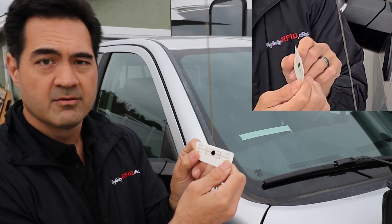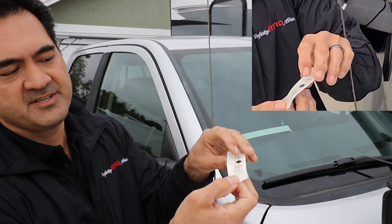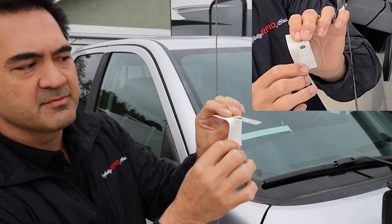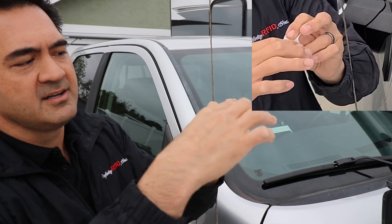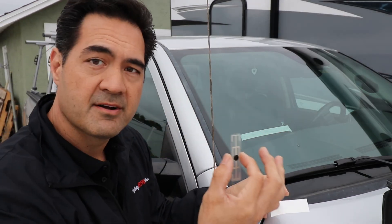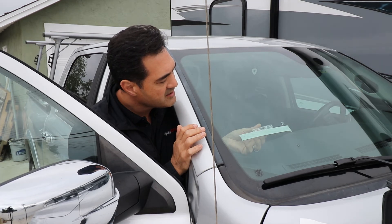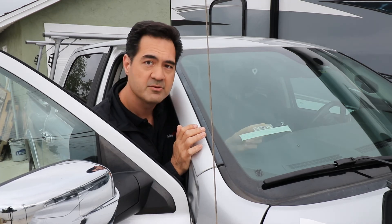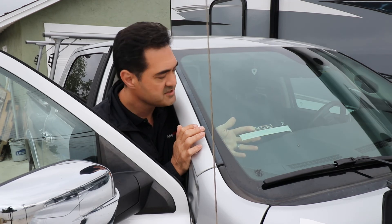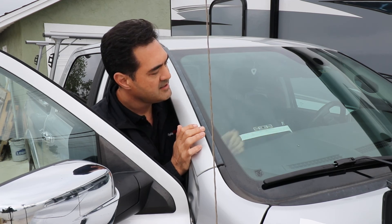Always be careful when you remove the liner from the tag. Grab the edge and peel the liner away from the tag — keep the tag unbent while you peel. Then grab the edge of the tag; you don't want to touch the face of the tag or the adhesive side. Take the tag to the inside of the windshield — I've got my guide tape right there showing me what is level. Go ahead and transfer the tag to the windshield very lightly, and once it's where it needs to be, take your finger and rub the tag to seat the adhesive onto the windshield.